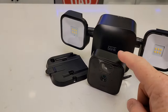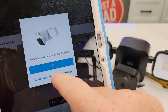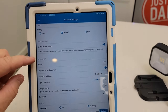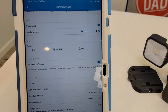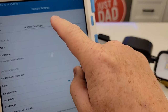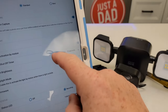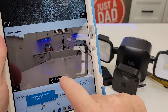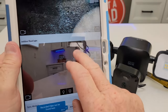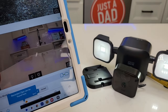As soon as I hooked the camera up and took that piece of plastic off the batteries, this notification came up. I'm going to click 'Customize Flood Settings.' It tells us the battery level, light activation by motion, and auto shutoff — there's a 15-second timer option. The floodlight settings are underneath the camera settings; if you scroll down it's kind of hidden, but you'll see 'Floodlight' there. Now on my camera view, I can turn the floodlight on and off with these two little buttons. Click that button and I can turn the floodlight on, then turn it off.